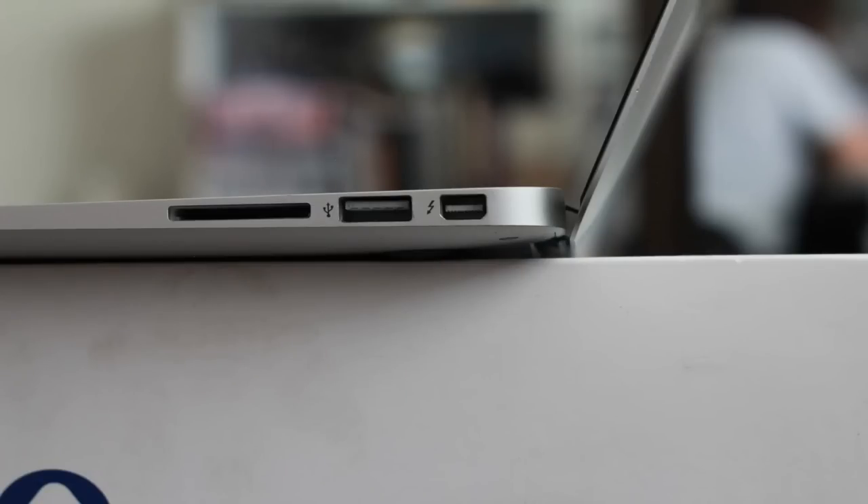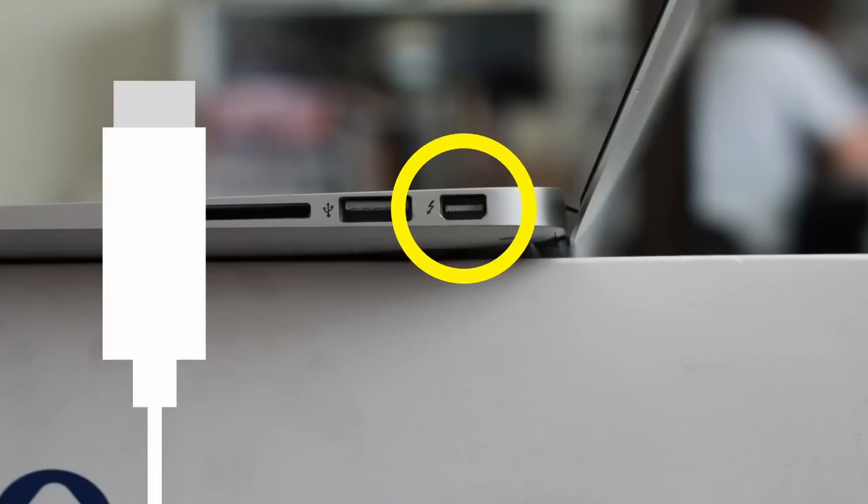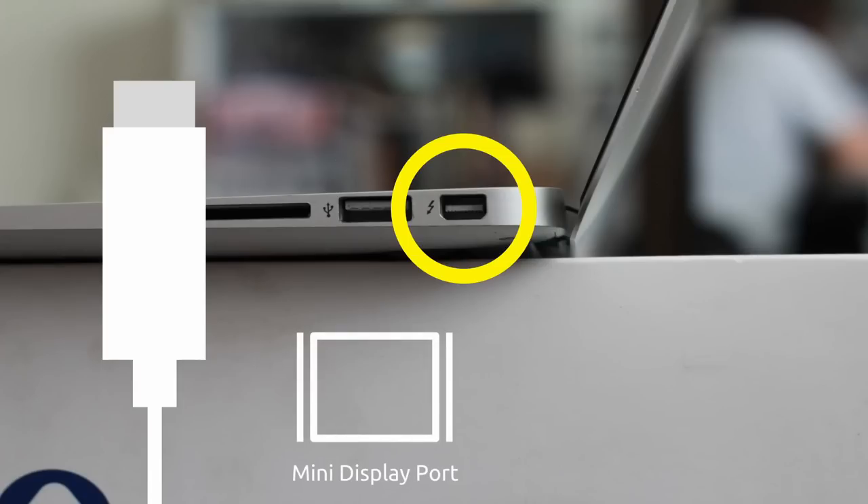You need to understand what connects the Akitio Thunder 2 to your Mac device. There is a technology called Thunderbolt, which serves a wide variety of purposes. We'll be using it for our Mac device to recognize the graphics card. I indicate on the screen what a Thunderbolt port looks like in the yellow ring. The plug looks similar to this drawing I made on the left, but be warned: do not mistake this for Mini DisplayPort. They literally have identical-looking plugs, but you can distinguish them by looking at the symbols. Mini DisplayPort is only capable of outputting a video signal, so if you only have Mini DisplayPort, you'll be unable to run this setup.